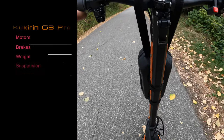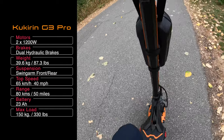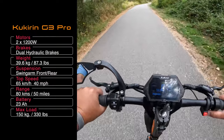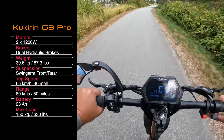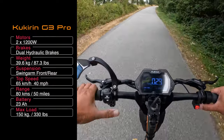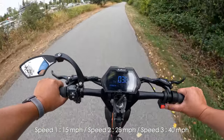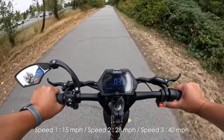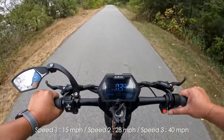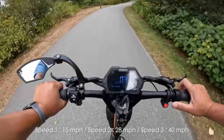Let's gear up and go for a ride. First thing, turn that key, hold the gear button for three seconds, and the display is on. We're in first gear right now. There are three gears — we're limited to 25 kilometers an hour in first, but in second and third we go up to 45 and then 65 kilometers an hour for top speed. You can see we're in single mode, so it's only the rear wheel. It will take a little bit longer to get up to speed. We are going up a slight incline. If we hit that red button, we go into dual and we get considerably more power because we have the front wheel going at the same time.